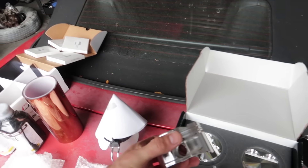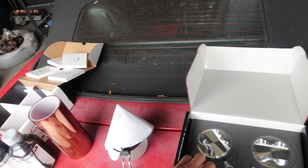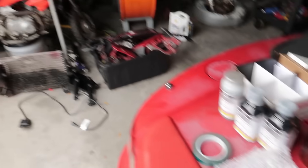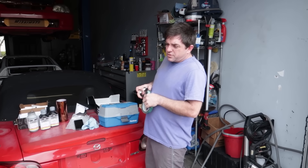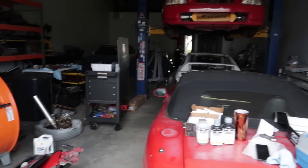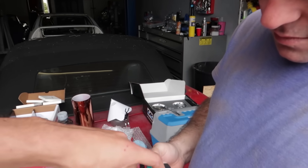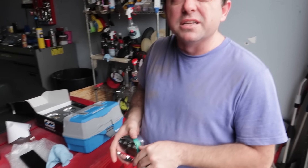It's insane when you look at the difference between mine and Chris's pistons — his are raised for high compression with the 1.8, and they look so much bigger. Just 0.2 of displacement and the pistons look that much bigger. We've now got the four pistons in the oven baking and the temperature's already rising. We need to get it sitting at 300 degrees for 30 minutes.